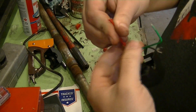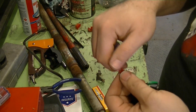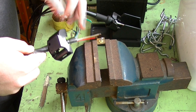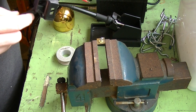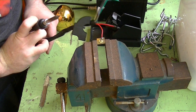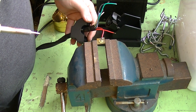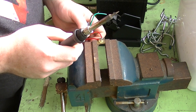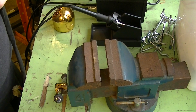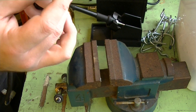These two wires go to my starter switch, these two go to the engine kill switch, and then these four wires go to my lights. I'm going to start with the starter switch wires — just clip the ends off to remove any corrosion, then strip the wires back. I'm going to solder them up one at a time. That first one was a cold solder joint — that's not going to fly. Since I don't have a third hand, now that the first one is in place, this one should be a little easier. I'll use my belly to hold it.